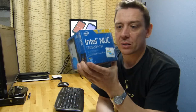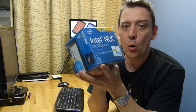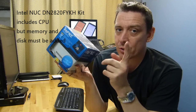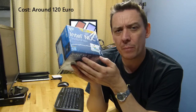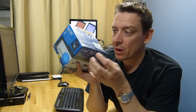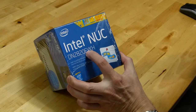Anyway, let's get into this Intel NUC. Of course it's a mobile computer — a very lightweight, very low power, and silent fanless desktop mini PC, which has the Bay Trail M processor inside. This is the N2820; the recent one is the N2830, which has a slightly faster clock and supports the Intel Media SDK a bit better. We're looking at the DN2820FYKH here.